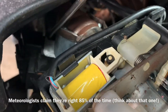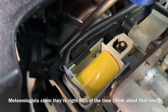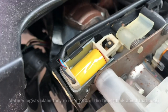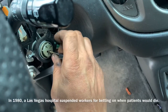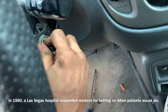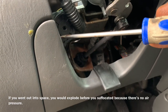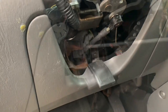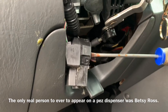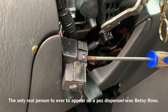We're going to push down on it and push out on it. When we get a little crack at the top, we should be able to slide it right off. Now inserting our key in the ignition, pulling this portion of the ignition out from underneath the cover, sticking our screwdriver in there and turning it — we can start the vehicle.